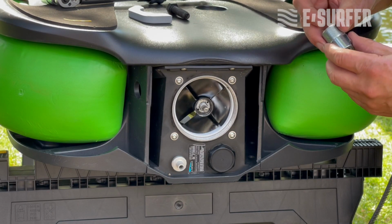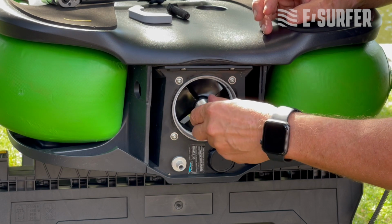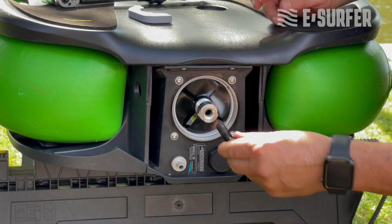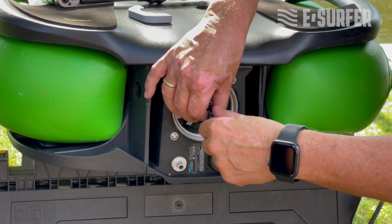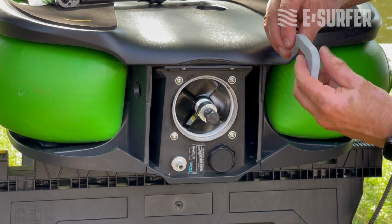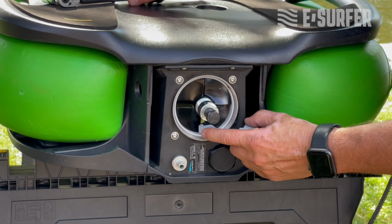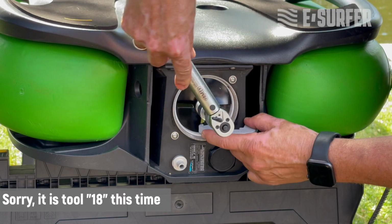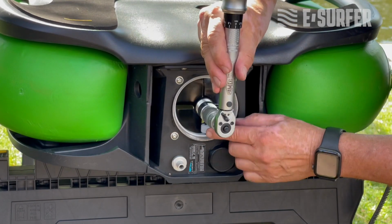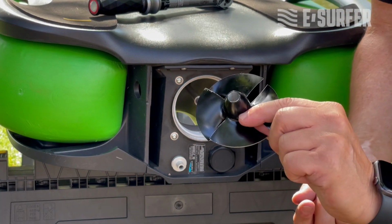After we remove the nut and the washer, we take the special tool here for the impeller and put it on by hand clockwise, and you have to screw it at least 4 times. Then you take the black screw, also by hand, again clockwise. Okay, then you take the tool close to block the impeller again. And with tool number 17, clockwise, you can now remove the impeller. And you see it will come out immediately. Then you remove the tool and you have your impeller.